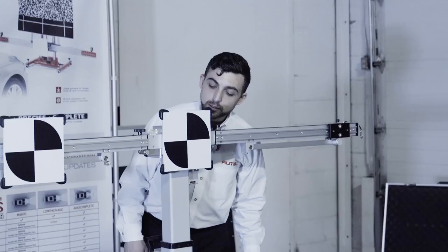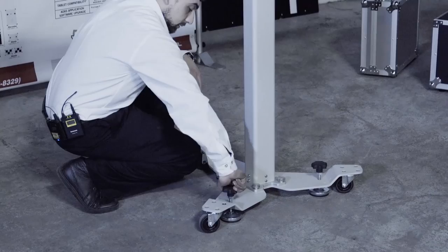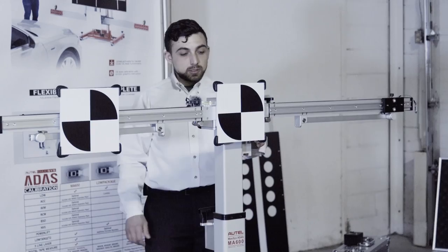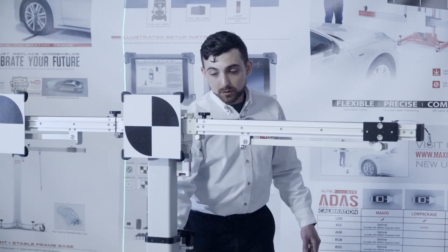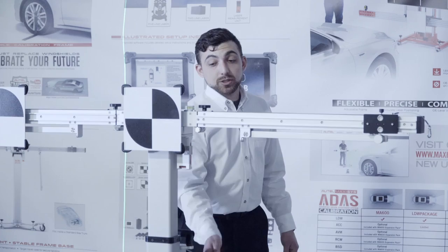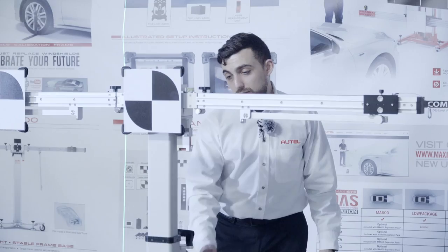The tool asks us to level off the frame. Back and forward look good; left and right need a little bit of adjustment. The height is 1450, just like the other one. This frame uses a digital height measuring device — a digital tape measure — that allows us to read the height in motion, so we can watch it change from 1340 up to 1350, up until our 1450 value. Since this one doesn't have a motor, it's all manual crank.